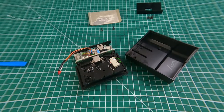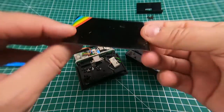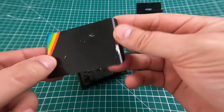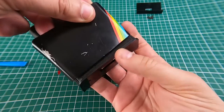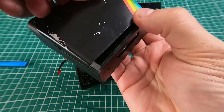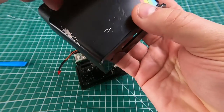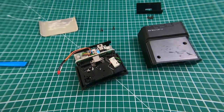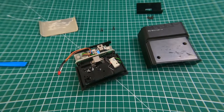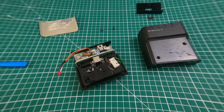Just be careful when you prise off that metal plate — be very careful because it will bend. Don't prise it off from the front edge because that bit seems to bend more easily. Tease it up and then pull it off from the back. Liking and subscribing is always appreciated — I'm having a bit of a retro moment at the moment so there might be a few more videos about this sort of stuff. If you've got any particular preferences, make a comment, and thanks for watching.